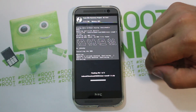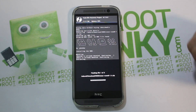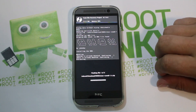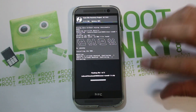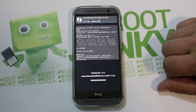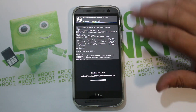Swipe across to install the ROM. There's a nice little 3D-looking graphic as it installs. On any ROM, as you should know if you've flashed before, on first boot give it up to 10 minutes. If it doesn't boot in 10 minutes, go back to recovery, restore your nandroid backup, and figure out what went wrong — maybe a bad download. That's always your safety net.